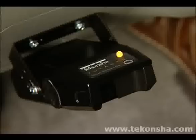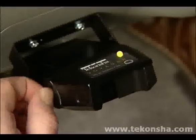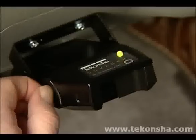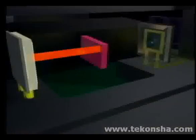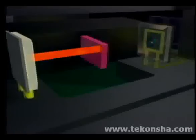You will want to move back into the green by rotating the level knob on the left side of the control clockwise toward the rear of the vehicle just a little at a time. What you're doing here is setting the sensor at the transition point just between the green and the flashing red.